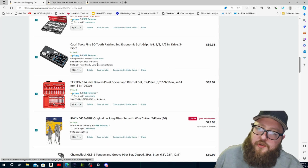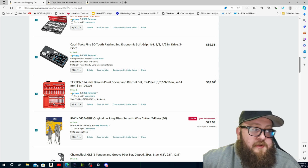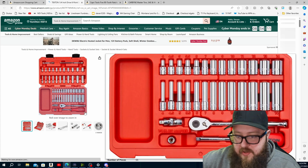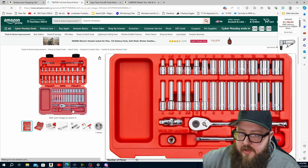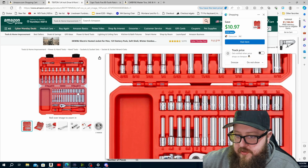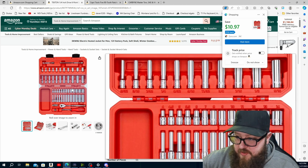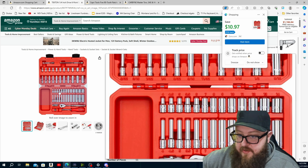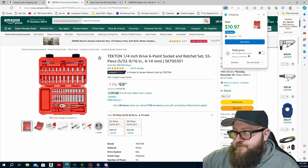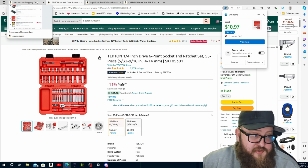And then for the quarter-inch socket set, we're going to go with Tekton, because for $69 you can get all of these sockets and a ratchet and extensions. And then this little bit driver thing doubles as an extension. You've got your SAE quarter-inch and your metric quarter-inch, and you will use quarter-inch in the automotive field so much for dash work, especially these half sizes. The 4.5, 5, 5.5, you will use them for dash bolts all the time. But yeah, it's a super nice set from Tekton. Tekton makes a darn good ratchet, so definitely go check that out.